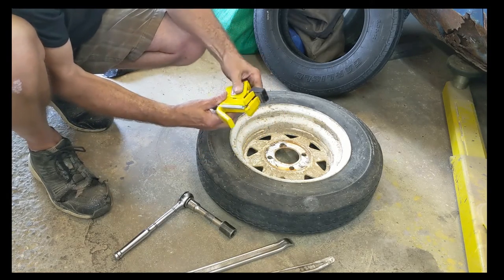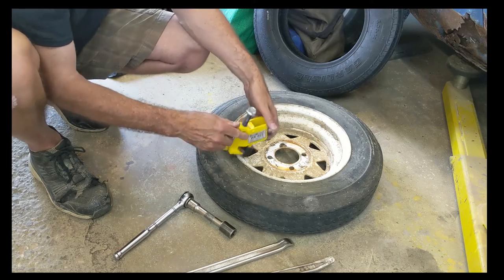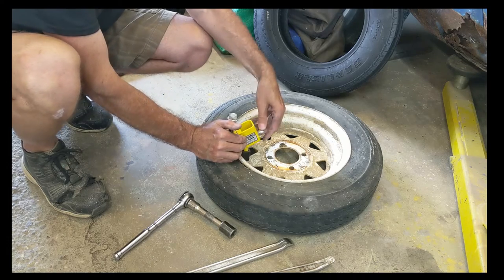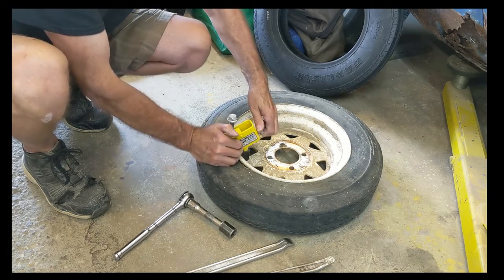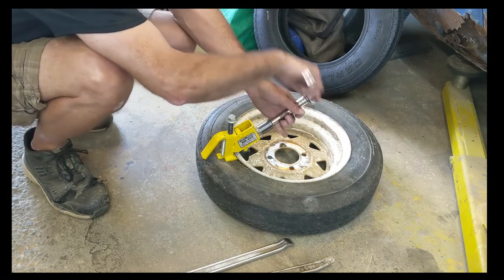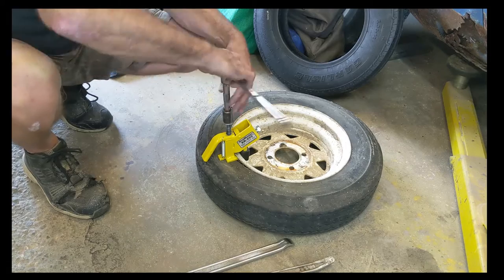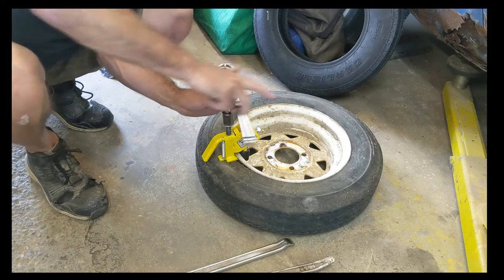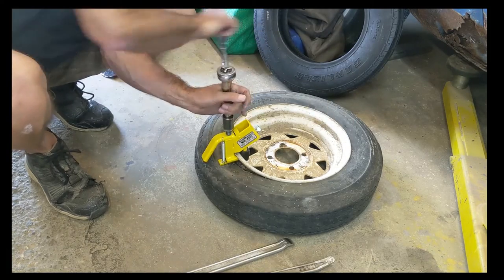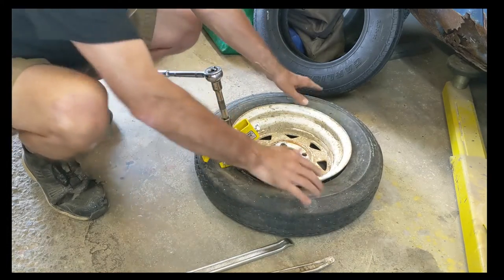You may as well put the bead buster on — no sense sweating, it's already hot enough here today. I've got to return the bead buster all the way to the up position. Give it a little push in, tighten her down. With these little tires, you can probably almost tighten them by hand. Give her a little snug. Now the bead's broke on these.